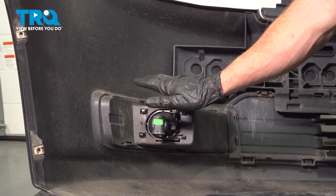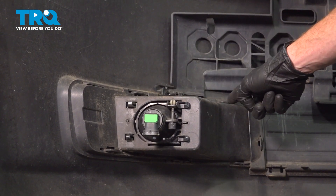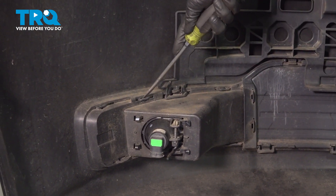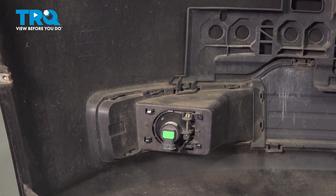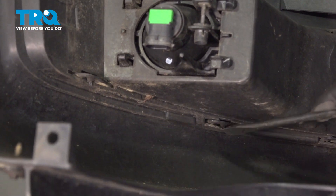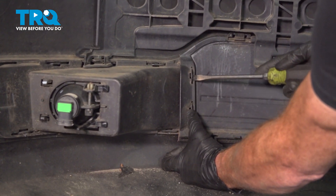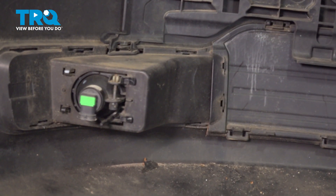With the bumper cover assembly on the floor, we're going to continue on to removing the fog lamp bezel — that's the area you can see along the front. To remove it, you're going to find that you have several clips, some along the top and some along the bottom area. Press down on that locking tab and gently start pressing this through just a little bit. Once that one's broken free, continue on to all others. Now I'll tilt this so you can see the lower ones. Once all eight of those clips are dislodged, let's make our way to the front and remove that bezel.